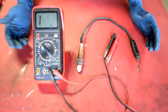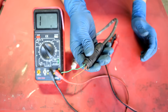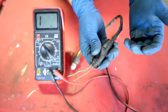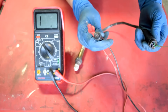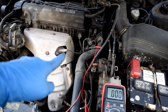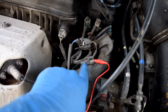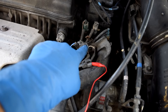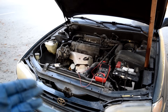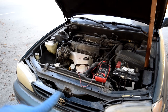If the heating circuit checks out — or if your check engine light is for the O2 sensor signal — next test whether the sensor can put out voltage. Identify the signal and ground wires on the harness side and back-probe them with your multimeter probes, set to 2 volts DC. Connect the red lead to the signal wire and black to ground. Start the car and wait about 15 minutes from a cold start to ensure it reaches operating temperature before observing your multimeter reading.